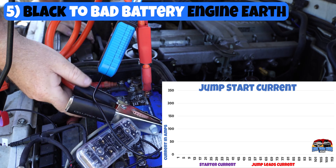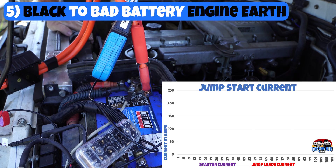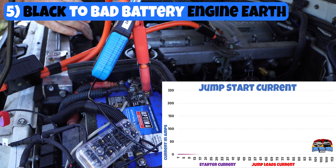Now when you're doing the final termination, you don't want to do it to battery negative. You want to find somewhere substantial on the engine, preferentially without any paint on it, not too much grease, that will take the negative lead. Because it'll probably spark a little bit. And charging batteries like this can emit a flammable gas — hydrogen gas. And you don't want that and sparks combined, because that causes a fire.